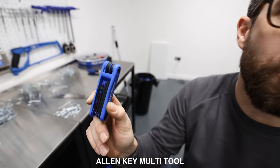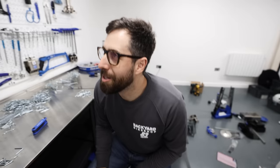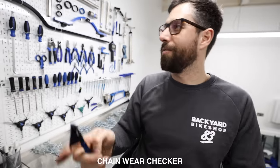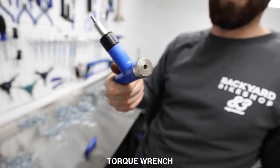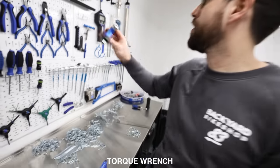To finish today's video, Nick's top five tool recommendations for someone buying DIY tools. Number one: the Park Tool AWS-10 — don't buy any other brand, best multi-tool in the world. Number two: the CC-2 chain checker — if your chain wears out you'll destroy your chain rings and cassette, so catch it early and save money. Number three: a torque wrench, this one goes from 4.5 up to 6 Newton meters — good for most handlebars, stems, and seatposts.